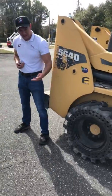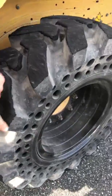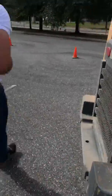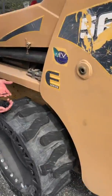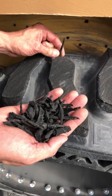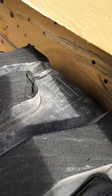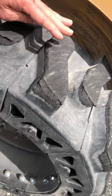You can tell our tires right here — you can see the edges of our tires because we do have a crown. The edges are still very good right here in comparison to the segmented tires, where you can see all these long pieces that have chunked off. This is only 15 to 20 minutes of use, and you can see how all that inner edge and outer edge right here is getting destroyed because there's no crown.